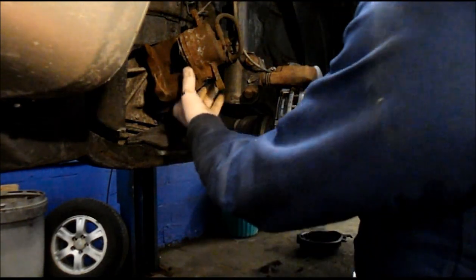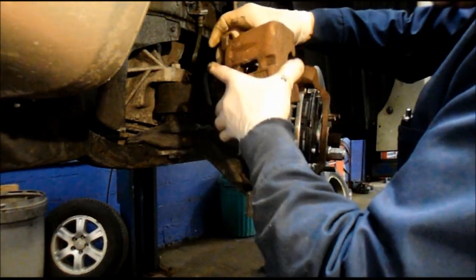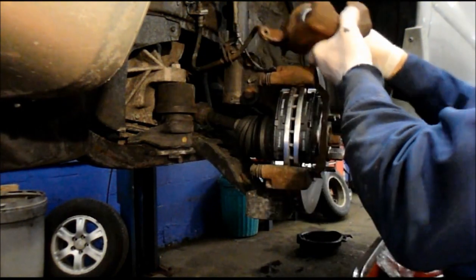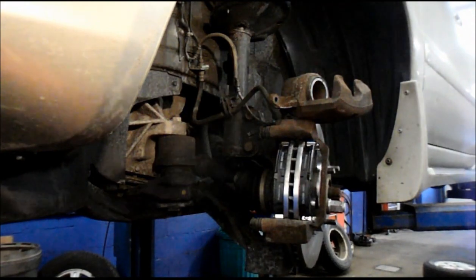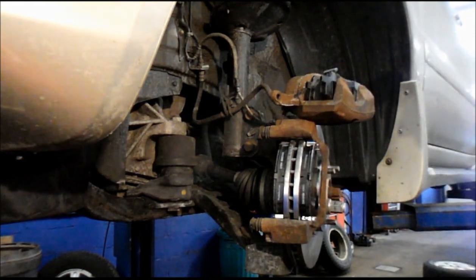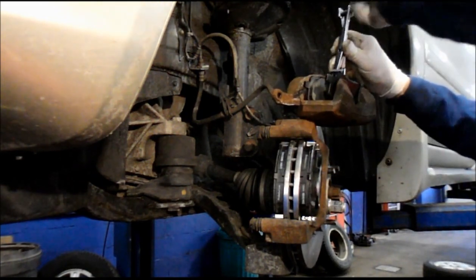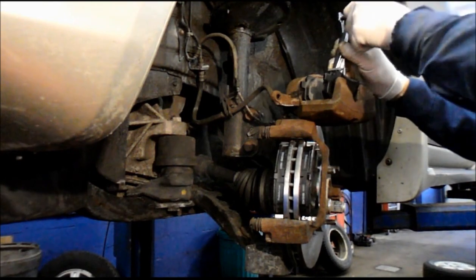Okay. And once you've got the brake pads mounted in there correctly, you'll take your caliper and slide it over the top. Most of the time you won't have to push the piston back in because we already did that. But actually you will have to go just a little bit more. So let me show you how you can push the piston back in. Lots of different tools they have out there on the market. This one here I like because I've been using it forever. You just put it in here like this, and you slowly turn it in, and it pushes the piston all the way back into the bore, so that it'll accommodate going right over the top of the new brake pads and the new rotor.